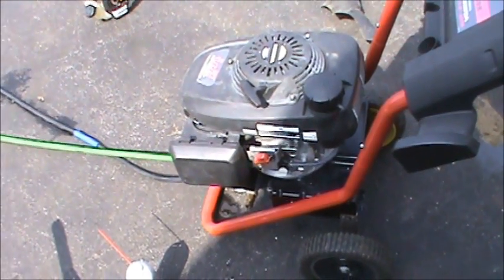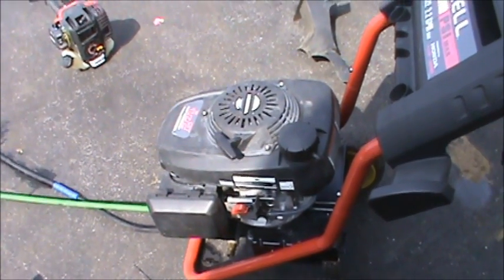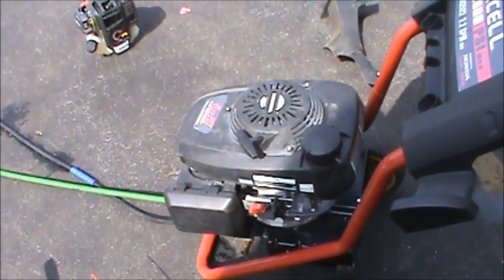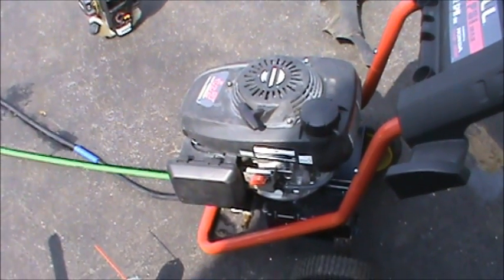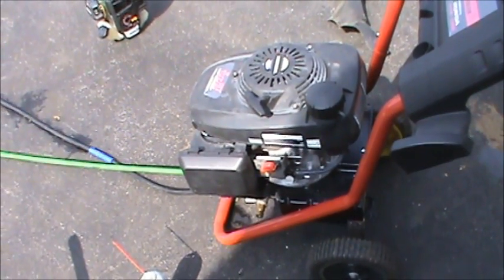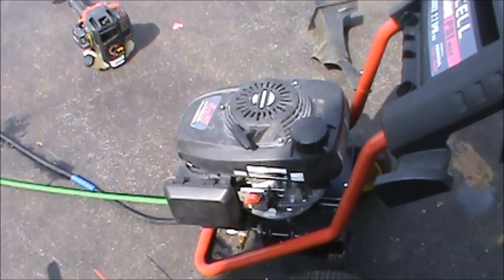That's it with this repair. As you can see, it's pretty simple — it took me less than 10 minutes to do it. I would recommend doing the oil seal repair because that's really the right way to fix it. That way, if you're running a lawn mower on hills and it generally leaks, you can keep your oil filled all the way up — because you don't want to be mowing hills without your oil topped off. As the oil tilts, it won't oil your engine properly. You want to keep the oil at full capacity, which on this engine is about 18 ounces. I'm DoubleWide6. I'll put a link to the oil seal in the description so you can get it from Amazon. If Amazon doesn't have it, you can get it from me — just send me an email. Thanks for watching and have a great day.